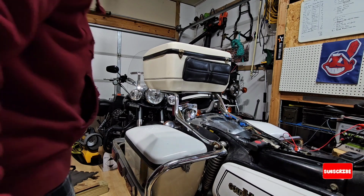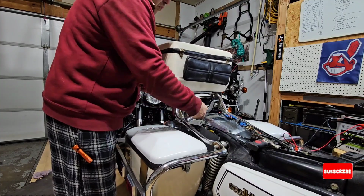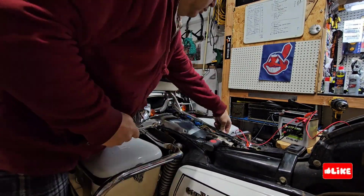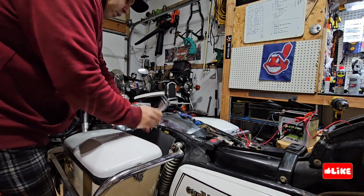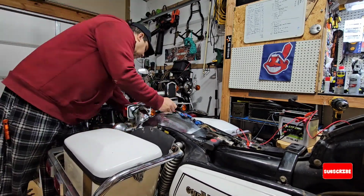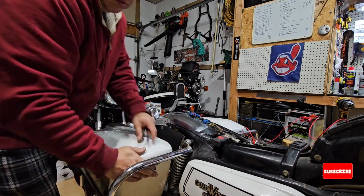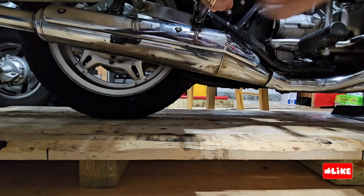So in the meantime that I'm doing the electrolysis, the second one, I'm going to remove all the touring pack. Has a lot of things. It's huge. So as you saw, the electrolysis is going and going, and electrolysis can take hours, days, weeks. So what I'm doing is I'm doing it for a day, and then flush, and then day, and then flush the water, so I can have new water with new electrodes. That is the baking soda plus water.